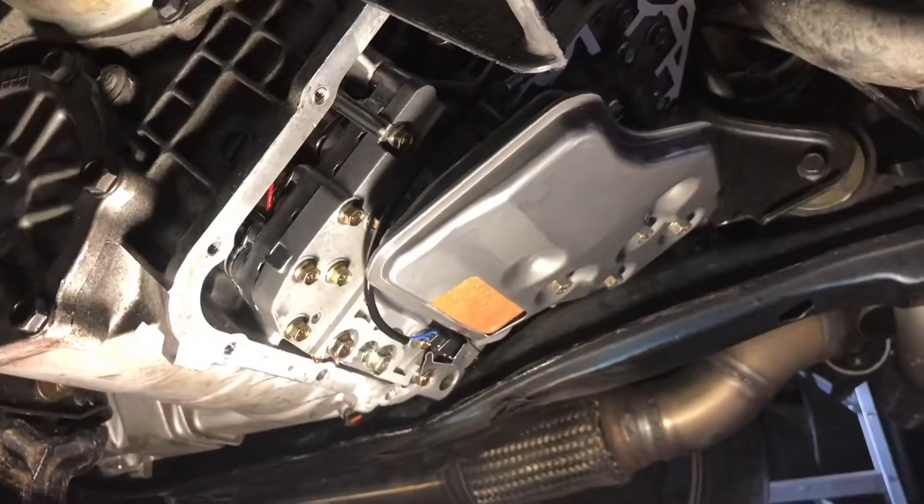Trans filter is back in. I finished up the car — the trans pan is on — but as you can see it's nighttime now. The battery was dead because the car sat for a month, so hopefully we get it jump started. I put two or three quarts in with the car cold and then topped the fluid off with the car running. Back on the road — just testing everything out. She has all gears and has reverse. I even manually shifted it just to be sure.